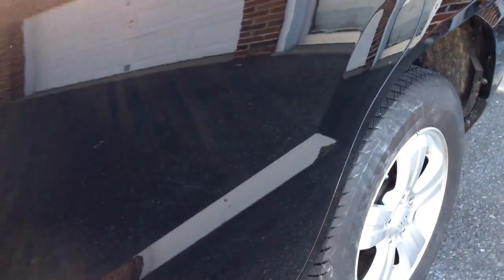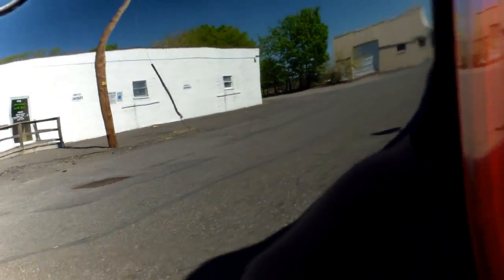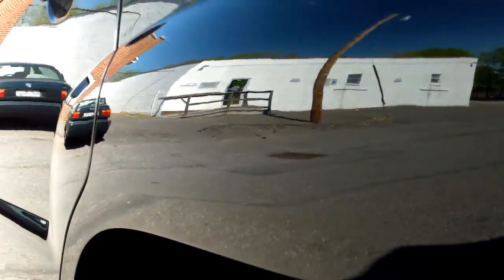I don't know if you recall the bodywork we had to do on the door. We had a dent right on that body line that we removed mostly with PDR, and then I had to give it a thin skim. You remember how bad that one was. Pretty much had to recreate that whole body line. Pretty proud of that repair right there.